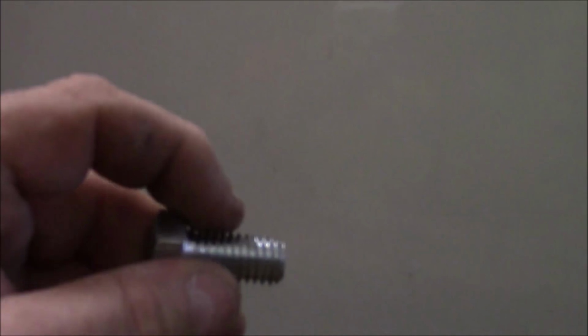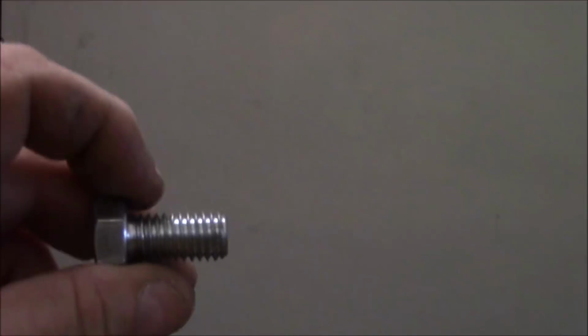So we already got them, we tested them. Now what we're gonna do is probably put some lock nuts on them, lock washers. And then we're also gonna put some lock thread on these, so they won't back out. The lock thread we're gonna use is the same product we've been using through this whole coach, M1.